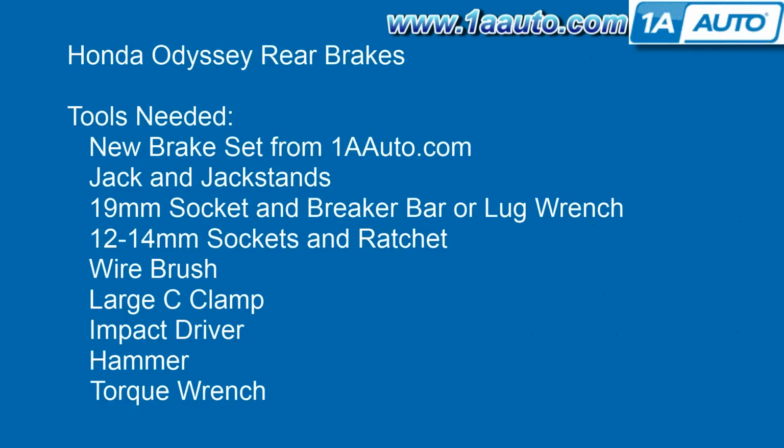Tools you'll need: a new brake set from 1AAuto.com, jack and jack stands, a 19mm socket and breaker bar or your lug wrench, 12 to 14mm sockets and ratchet, a wire brush. You may or may not need a large C-clamp, and you'll need an impact driver and a hammer if the original screws are still in your discs. Lastly, a torque wrench to put everything together correctly.